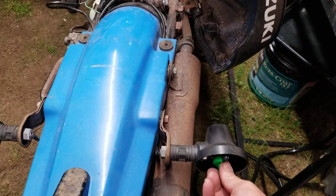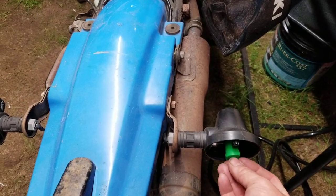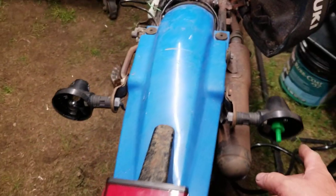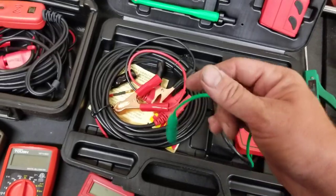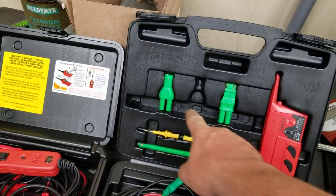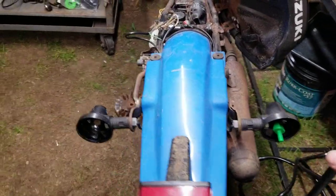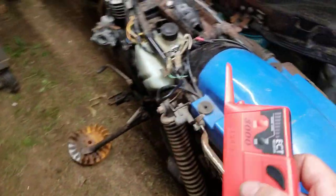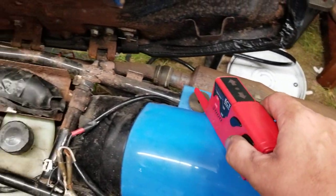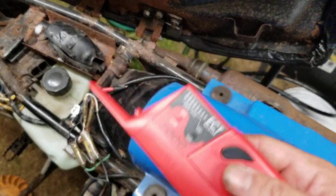This probe fits into the socket and is supposed to twist — that replicates the light bulb. Then I hook up my machine: this piece right here is the transmitter. I plug this green terminal into either one of the filaments, and it puts a tone in that wire. Then I use this wand and run it along the wire — boom boom boom — and the audio will cut out and I can find my short.